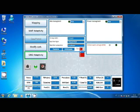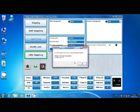Anyway, this parameter is useful in some CNG vehicles, but there's no rule about that. You have to try and see how it works. Okay? It's very simple. You select how many cycles, okay, and then you click on anticipate.